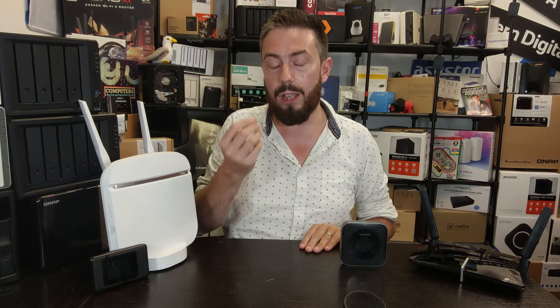You may get a router not knowing that the 5G SIM you're putting inside — which the device acknowledges — doesn't mean the hardware architecture, antennas, and network support can actually handle 5G. The result is you'll have a router that isn't giving you 5G, or worse, you've used a 5G SIM from Virgin, O2, or similar and aren't getting 5G performance. Double-check it doesn't just say '5G SIM ready' — confirm it actually supports 5G. Also verify you'll be somewhere with 5G coverage.